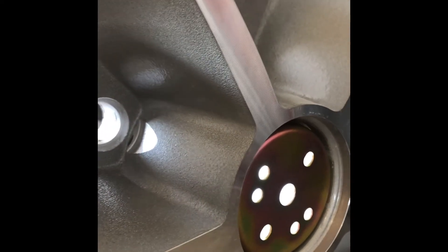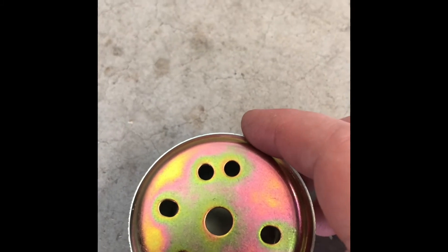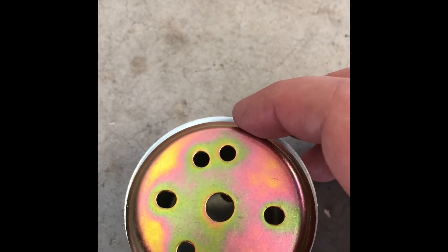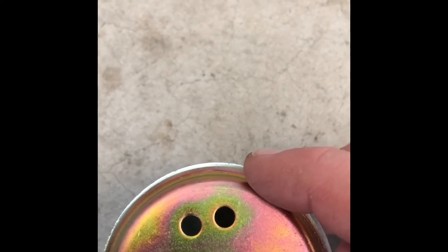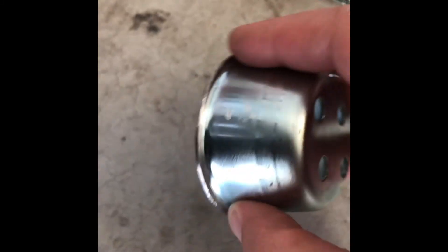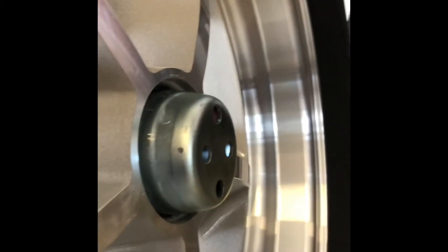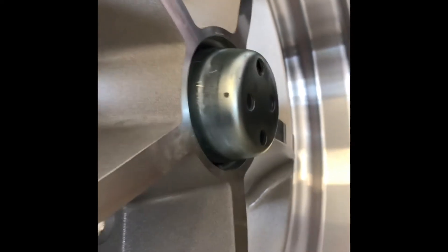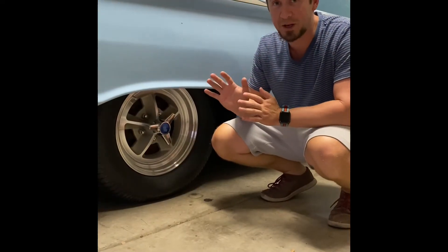With the adapter, the spinner still goes out about the same point right below the flange of the wheel. When you look at the two together it's only a very small difference in diameter — about a millimeter or so total. I just took and ground a little bit off of one already — it'll poke out how it's supposed to, so I can bolt the spinner on there like it's supposed to. It takes about five minutes of grinding each.